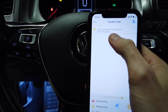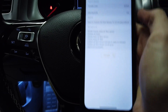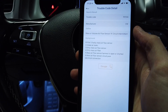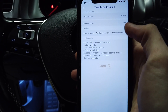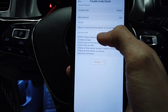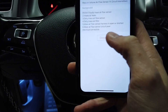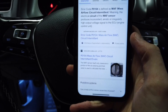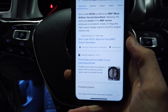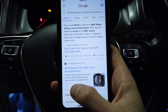Mass or volume airflow sensor A circuit intermittent — and that's correct because that's exactly what I disconnected: the sensor on the intake manifold. We can see that the fault is Volkswagen-specific, and we even have background information about this fault and a Google button to check out more information about this issue. Now I'm going to reconnect the sensor and try to remove this fault.